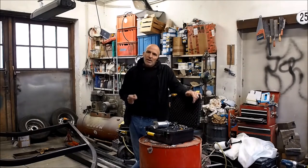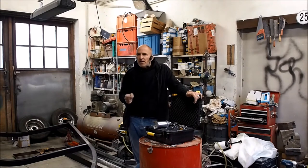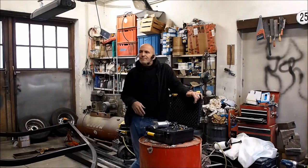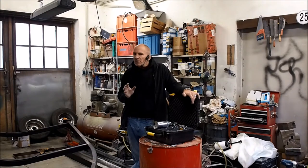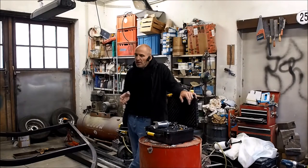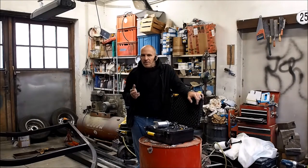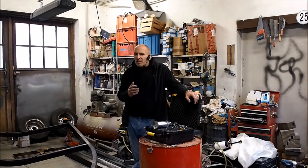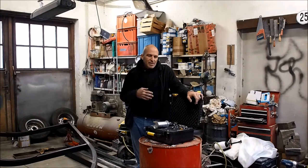So what I do with my clear coat is I do not put any thinner in it. The clear coat is mixed with hardener, usually 2:1. And then the manufacturer normally says around 10% of thinner. I do not put any thinner in. I spray it normally with a 1.4, sometimes with a 1.8. Again, if it's a flat surface, 1.8 can put on more material, and it's easier to cover the